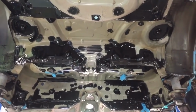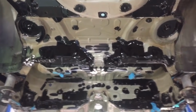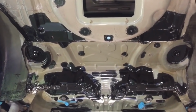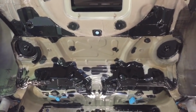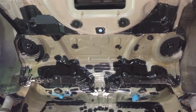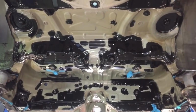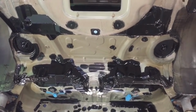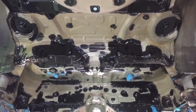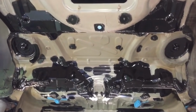The corrosion protection work is finally finished on the CSL. We're up to about, we estimate, 45 hours we've put into this chassis now in the pursuit to hunt and find and remove all traces of corrosion, even under the seam sealer that hasn't shown any signs. We've located problems that have been hidden and rectified them by taking it back to bare metal using the POR-15 metal prep solution, and then the POR-15 rust preventative paint, which is what these black items are here.